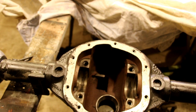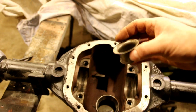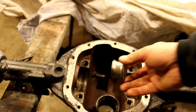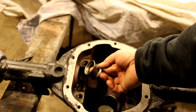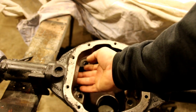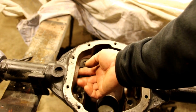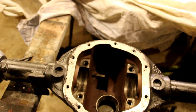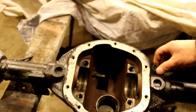To get the housing to this position I cleaned it out, put solvent down the tubes and ran rags through there. If you happen to knock this guide out — it's just a guide your axle shaft sits in — sometimes you can knock those out. The oil seal holds it in, so if you do knock it out it's not the end of the world. We're going to set it in there, stake it with a punch, and put the oil seal in.